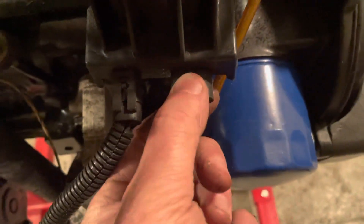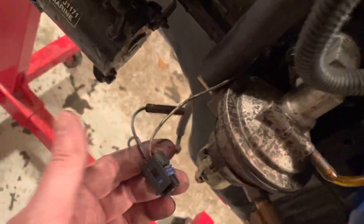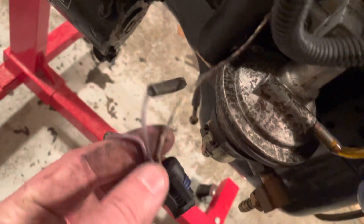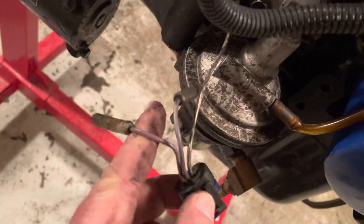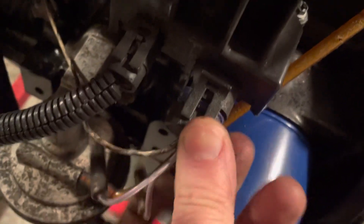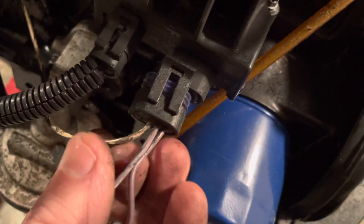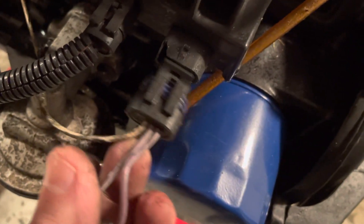You've got one wire going from the ignition coil to the distributor. You've got this connection here which is capped off — it's not used. It's supposed to have a rubber cap over that connection because this is a carburetor vehicle, so it doesn't have electronic timing to a computer. There's another connection down here which was plugged in right here — I'll figure out what that means later.